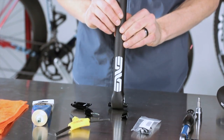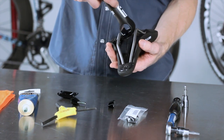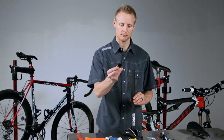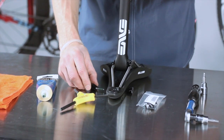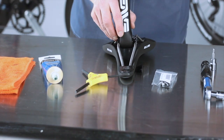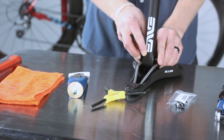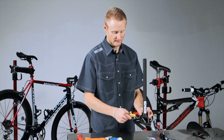Hold the seat post upside down. Take your standard rail saddle and simply slide the saddle onto the cradle. You can rest it on the table or your workbench. Take your lower cradle and slide it through the other side. Now take your wedge with the bolt in it and slide it through one side — you can see the threads right there. Take your other wedge, align it with the threads, and begin tightening with the five millimeter until the threads catch.